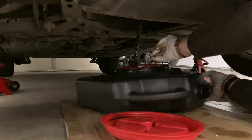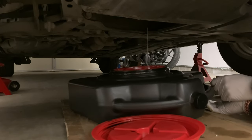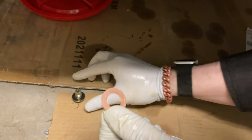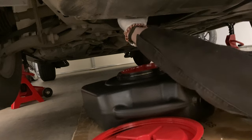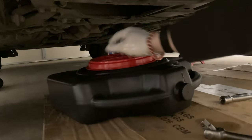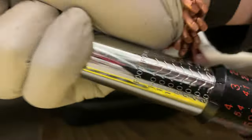This is called an oil pan. We're going to break free the nut there and drain out the engine oil — just like that. We saved it in this container here. We're going to put the drain bolt back, but first we're going to install a copper washer just like that. Now we're going to screw it in there, tighten it up finger tight, then we're going to go to 24 foot-pounds.